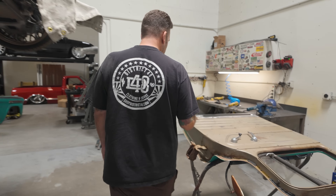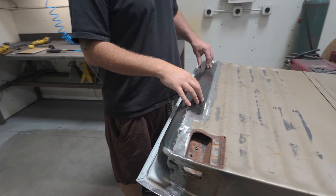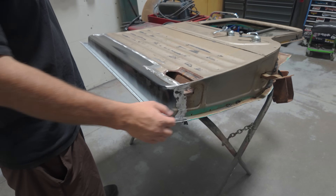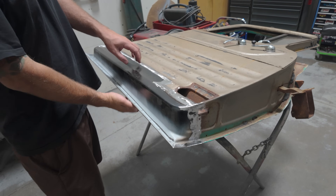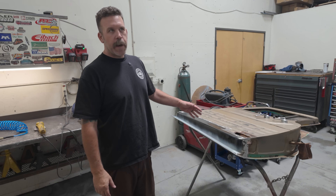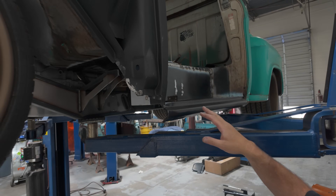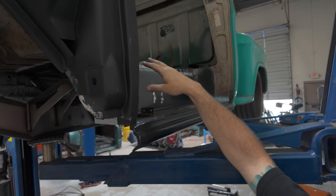You can see the driver's door on this side. Not quite done, but this is a replacement piece that we got from Chrome Guy. The outer piece from here down, Chris made himself. Then it gets pinched, folded around, and he'll come back and spot-weld this. So the whole bottom of the door is rebuilt. That door was worse — this whole pocket had to be rebuilt on that door. But on this door, it's basically the bottom six inches of the door, inside and out.